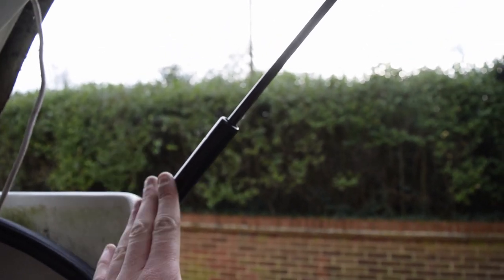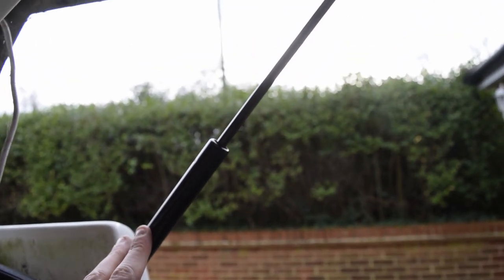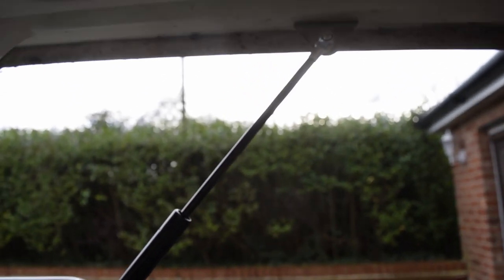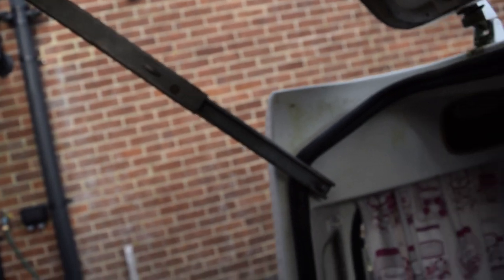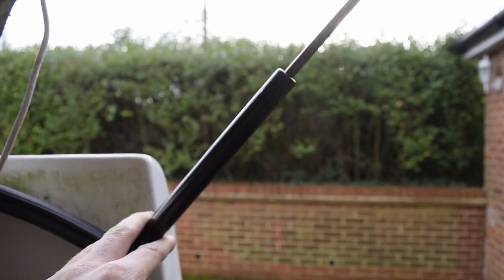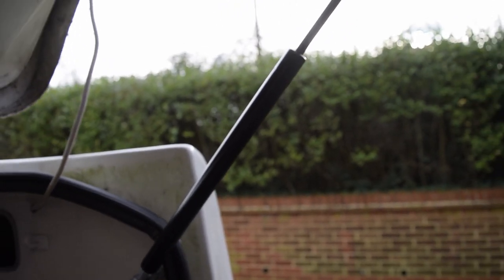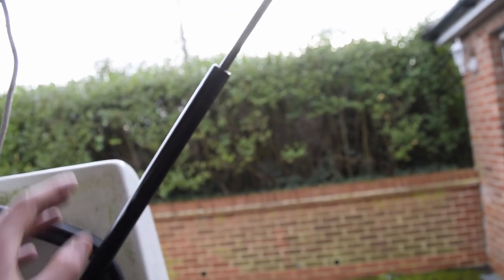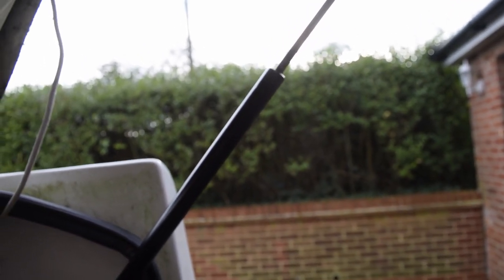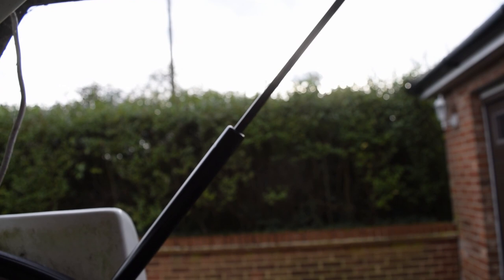With this though, the strut itself works perfectly. I like it. There is just one problem, and that is that the strut is just not powerful enough to hold the tailgate on its own. Currently it's up because we've got the older strut from the 1980s still on here, which at the minute is not being temperamental but has a tendency to be. So what I've got to do is take this back off — it's fairly simple, I've only installed it with a couple of bolts anyway — send it back and get something a bit more powerful. As a test piece, it's the right length, it all fits perfectly, and the clearances are all good. It just needs to be a bit more powerful. I've never used gas struts before in a build — it's a learning experience for us all.